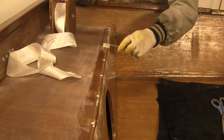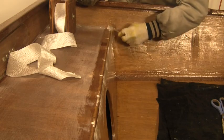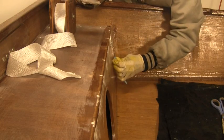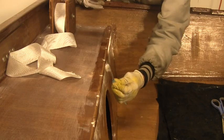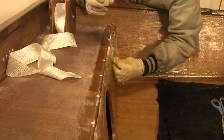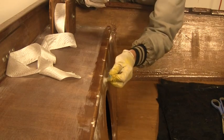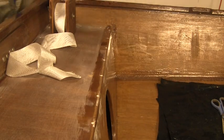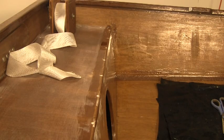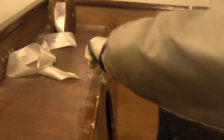Let's get some glass out. Got my toothbrush out for today. We'll put a little bit over the nose and along the edge here just to give it some stickability. I probably have enough epoxy on here to wet out the tape just by letting it soak. But don't get too much out there — it starts dribbling on you.